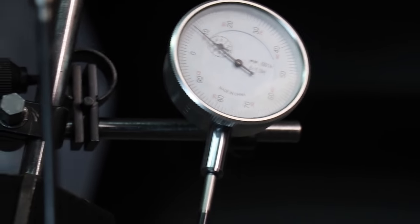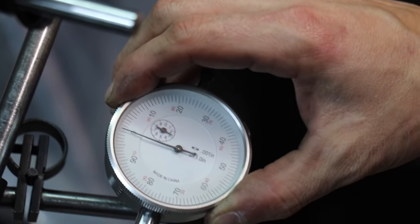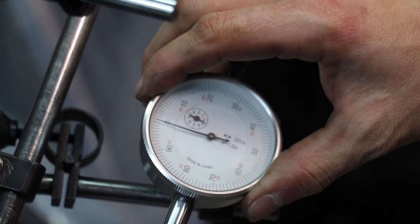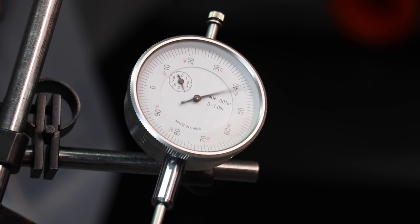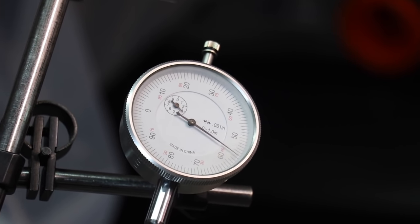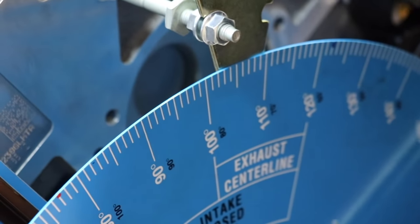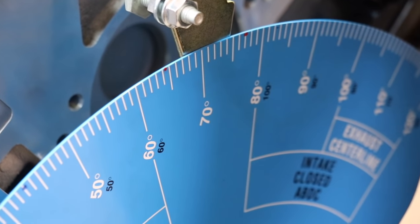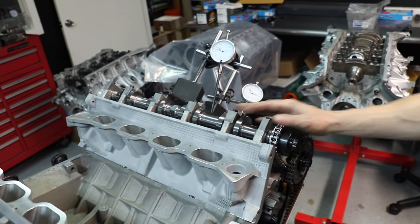Our first exhaust reading — going back past 50, going around another time. And 50 exactly. So we're kind of backwards here. We're going to write 112 and a half on the exhaust, 117 and a half on the intake. That's a five-degree split — so two and a half each — we're at a 115 lobe separation angle, just the wrong direction. We're going to need to add five and a half degrees of advance here. I really don't need to split these apart — there's some slop in the factory secondaries; if you ever need to widen the lobe separation angle, keep the crankshaft static and pull one cam away from the other and snug the bolt back up. There's probably two degrees of slop in the factory sprockets either way.